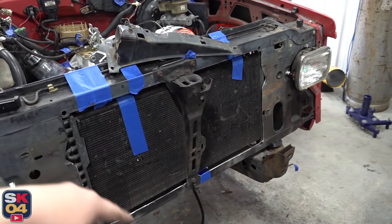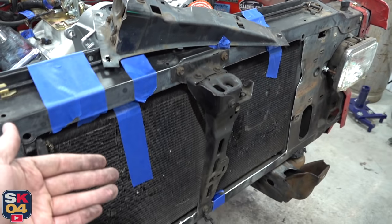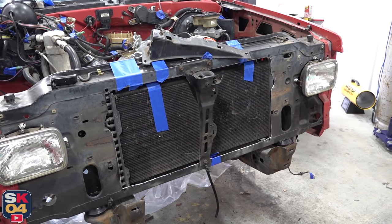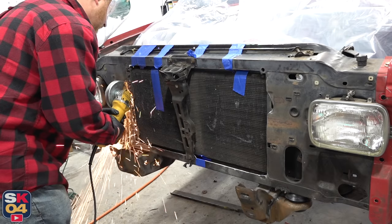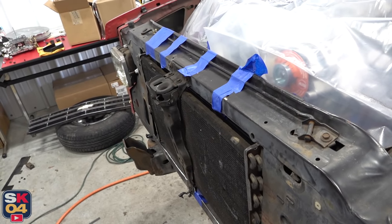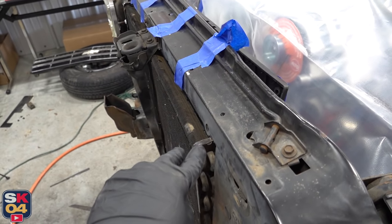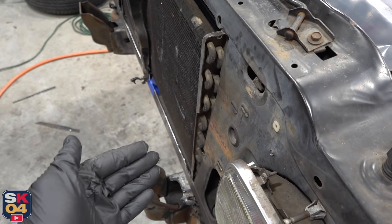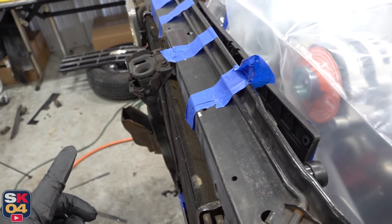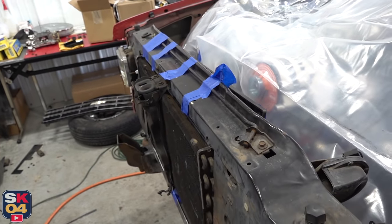I had an extra hood support latch piece off of one of my parts trucks — this is the one that was off this truck, so that's what it looked like before. I cut the whole intersection out. Now I'm going to go ahead and make this hole wider and see if it will all tilt. This is actually looking pretty good. The entire width of the condenser at the top is sticking past the core support while the bottom is still tucked in. I could notch this even more to bring it further forward, but it might not be needed. I'm going to cut a hole over there for the radiator filler neck because that's preventing me from tilting it all the way back, but I think this might work out.